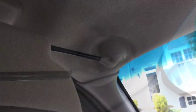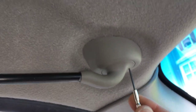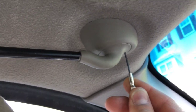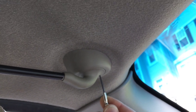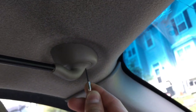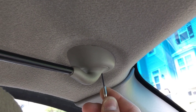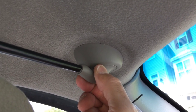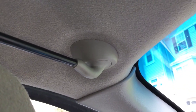Put the rod up in there, then rotate the visor counterclockwise — there it went, you should have heard it clip in. Keep rotating it to bring it down low enough so you can get up in here and pop that clip down. That's how you remove this kind of visor if you had to replace or repair it.